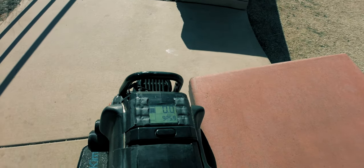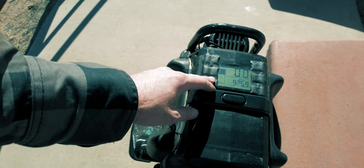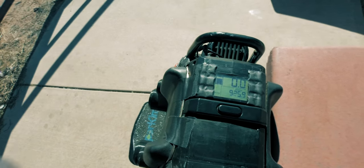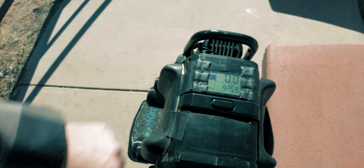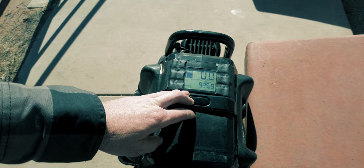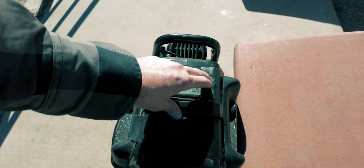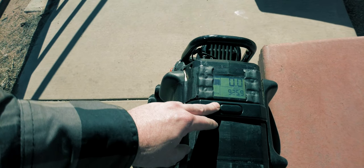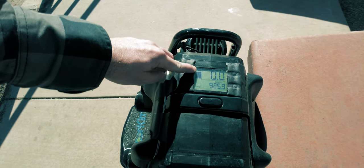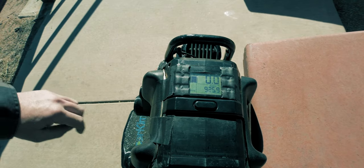The fourth improvement I made — after one of my buttons got eaten — I had it sitting upside down, I think on my motorcycle seat or in the back of my truck, and the rubber cap on the button just completely peeled off. So I have to push way deep down in there to use the menu settings. I used alien tape — a really squishy, gooey double-sided tape — to build a brim around the buttons, and then I put gaff tape over it. So if it's laying flat, the buttons aren't being pushed. And the gaff tape means they can't be sheared off anymore.